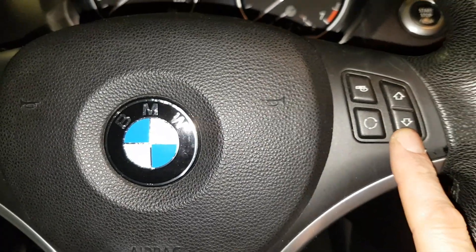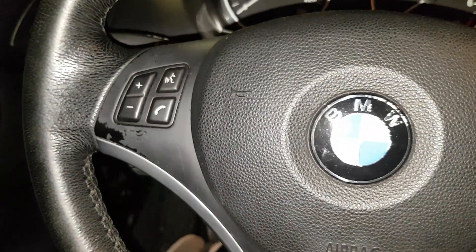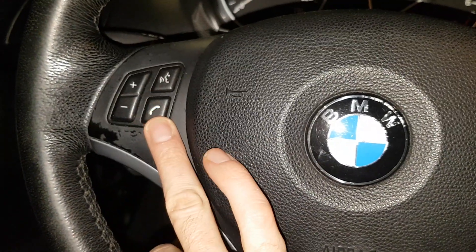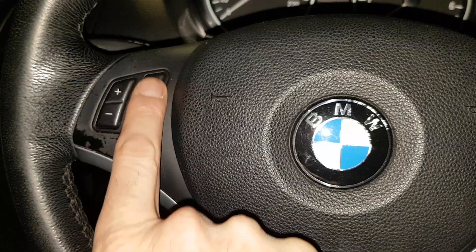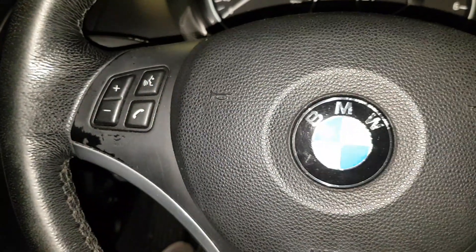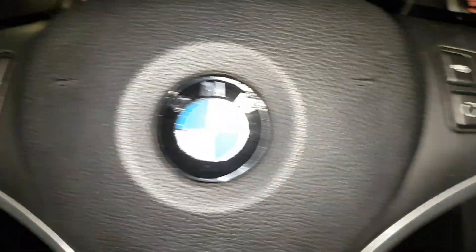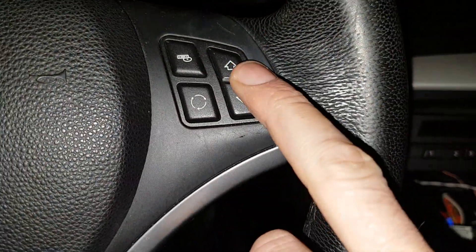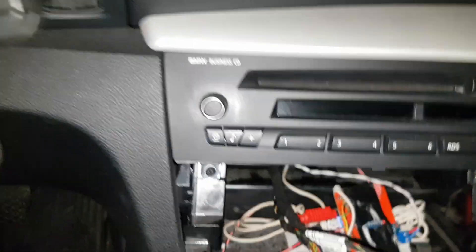Practically speaking: next song, previous song — volume is unchanged. This button starts and stops playback. If you get a call you can answer, and if you double-click it you can also call back. This button switches the function from Bluetooth to auxiliary input, or if you have a USB key plugged in, this board can play from the USB key. If you keep the up or down button pressed, it will increase or decrease the Bluetooth volume on your phone.